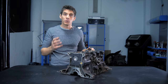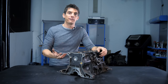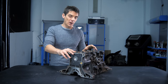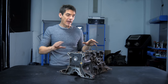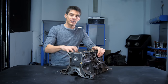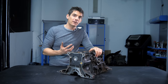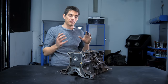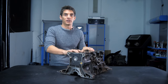There's one other type of engine block — a billet block — which you'd only really find in a one-off racing application or for restoration. A solid block of aluminium is taken and the engine block is milled out of it, with all the metal that's not needed machined away or drilled out using a milling machine. That's very expensive to do, so you'll only find it in the performance world. In production engines, it's cast iron or cast aluminium alloy.